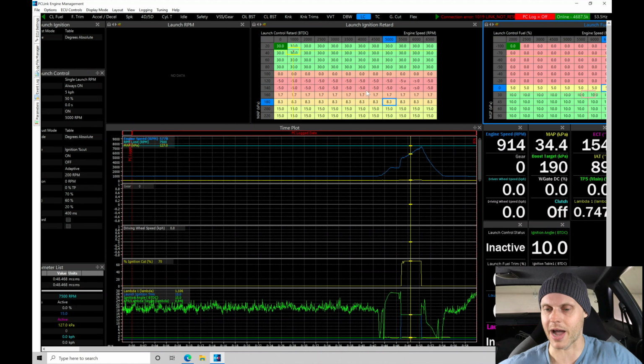It's going to be bouncing back and forth to where we want the timing to be at, and it's going to add additional fuel, so it should have a richer mixture, and the EGTs shouldn't be as bad. It'll be a little bit easier on the exhaust valves and a little bit easier on the engine. So the engine's run here long enough. Let's go and take another data log.